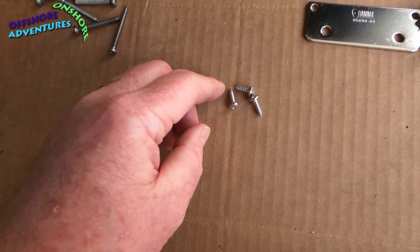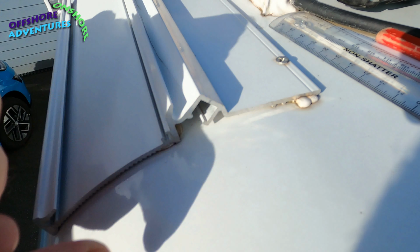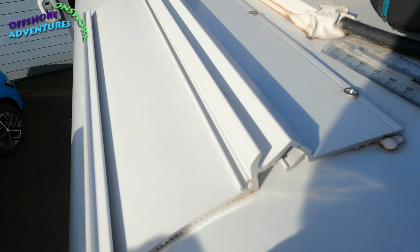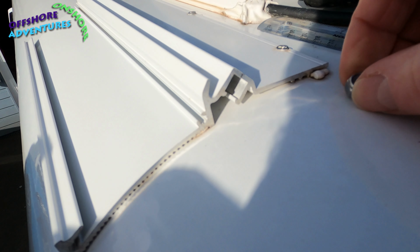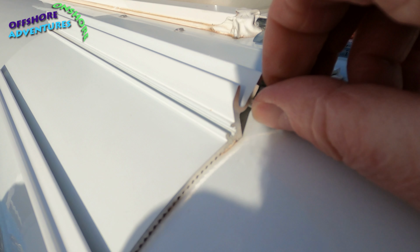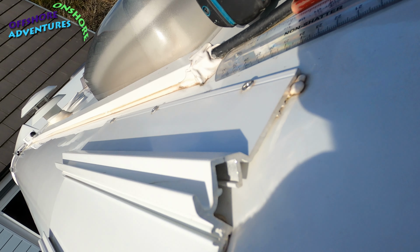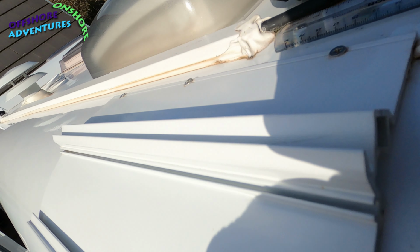And here you go, there's a reminder, we've got the brackets already fitted, top, middle, and then one behind me. This is the middle one. You'll see here, just there, that there's like a groove underneath. Now that is exactly the right size to take the M6 nylock, which would go upside down and then feed into that gap there. So we can just put that in, there you go. It slides into that channel and is held in that channel the right way up. It's about there at the moment. So I've got a long screwdriver to push it down as and when I've drilled the holes.